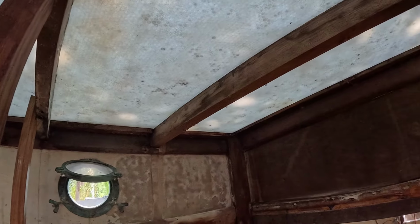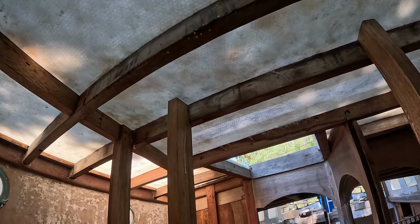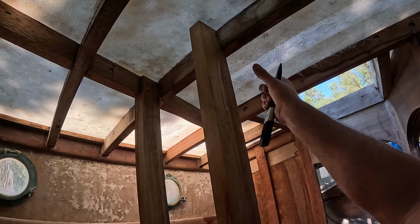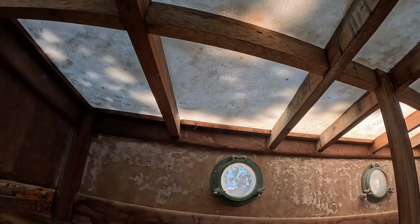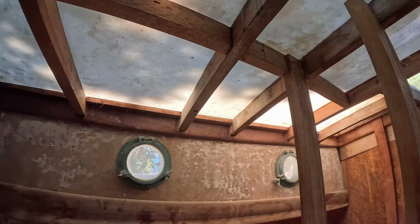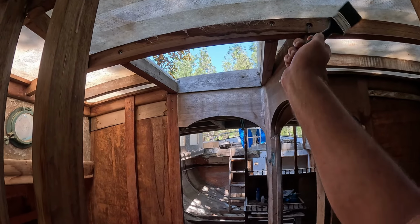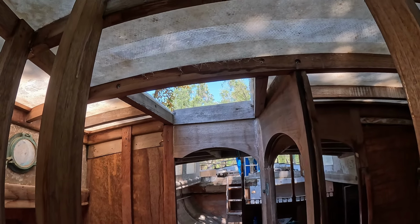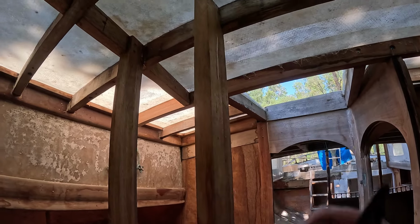Okay, that's good. We now have this roof area all done with a single layer of fiberglass. We're going to sand over it all. We're going to run fiberglass strips on the inside of here. So that might be the next step to do today: get the sander, let's clean all this edge up on the bit that's already been done. Start cleaning it up. Although I do also want to keep working on the deck area. So, two things. We can just let it all dry, we'll sand it all up and prep it all.